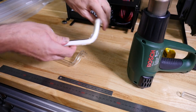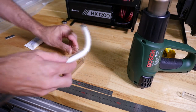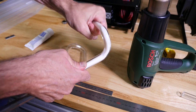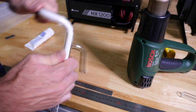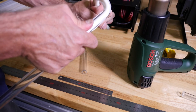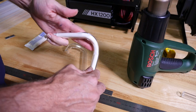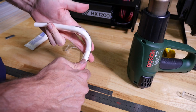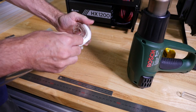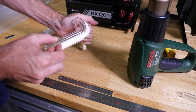That's actually a little bit too big now, so I'll just let it kind of relax back on its own until it's a similar length. This is actually EK tube. We don't do the Singularity Computers acrylic tube anymore — I did love it a lot and had a massive stash of it, which lasted a long time after we discontinued it. But this EK tube is also really good — it's nice and hard, which I prefer. I don't like PETG at all, and I don't recommend PETG. It's just too soft to get nice bends with. You need the tube to be firm and stable to get good offsets and bends without kinking, lines forming, or deforming.